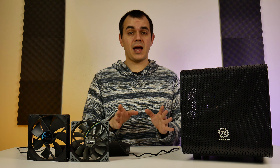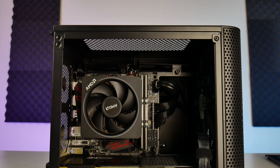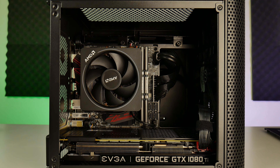Now, speaking of processors and performance, I wasn't really able to get a stable 3.9 GHz all-core overclock out of the Wraith Max heatsink that I'm using here. It's not that it's not a capable heatsink, but the thermal environment in the Thermaltake Core P1 unfortunately is a little bit lacking. And that wound up being the other portion of the system tuning that I did for this rig.